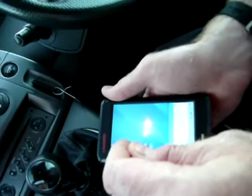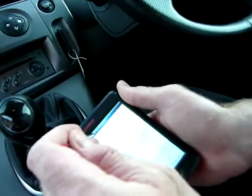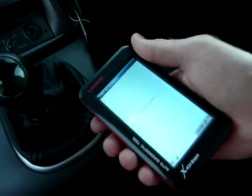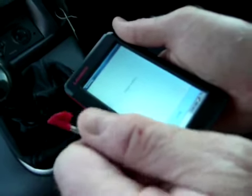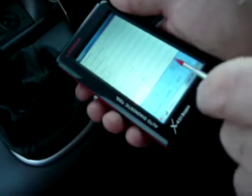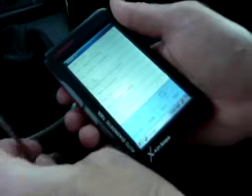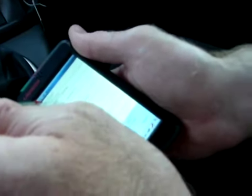Let's find and click Renault. Highlight Renault — OK. Version 38.0, which is about June 2010, the latest version. Press OK. Now it's analyzing data from the car — give it a few moments. Once it analyzes it, it will invite you to select the model. It's inviting you to select Modus, Clio, Clio 2, or Clio 3 — it's not one of them. This is a Renault Scenic, so next page. There's Scenic 2 — I'll highlight that. Then it comes up with Injection, Air Conditioning, Automatic, ABS, Airbag, Pretensioners, Park and Brake, Variable PAS, Instrument Panel, etc. I'm going to select Injection because it's going to be around that area of the fault.